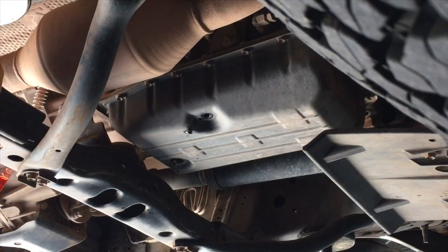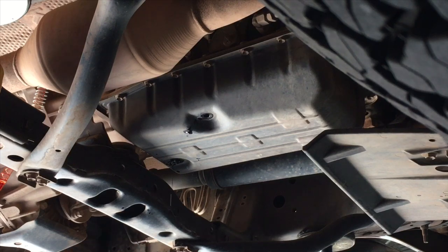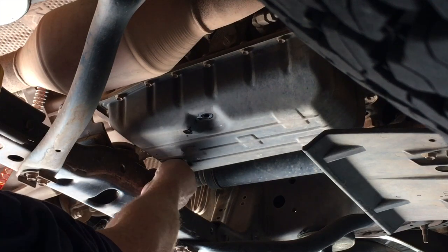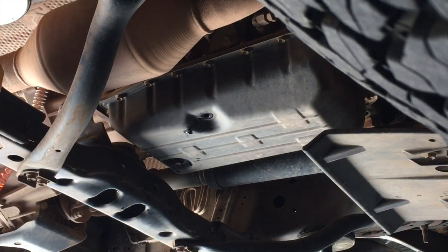We got cut off by a phone call, but that's okay. We've got the filler hose with the oil at the filler plug — we just need to add oil. The drain plug we're just going to put back in, finger tight — that's all it needs to be at this stage. We are pumping oil in up the top where the filler plug is. After quite a number of pumps, you're probably going to see some oil start overflowing at the check plug. That is not the correct level.